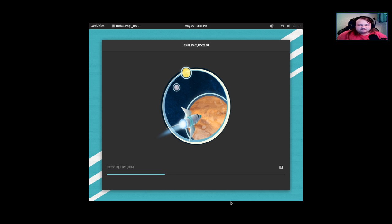Because they want everything with their computers to be open. You can do whatever you want with them. You don't have to jump through hoops to get things working. On a Windows computer, all the bootloaders for the operating systems are signed. Anything that is newer than Windows 7 has a signed bootloader. So you need to go and turn off Secure Boot.